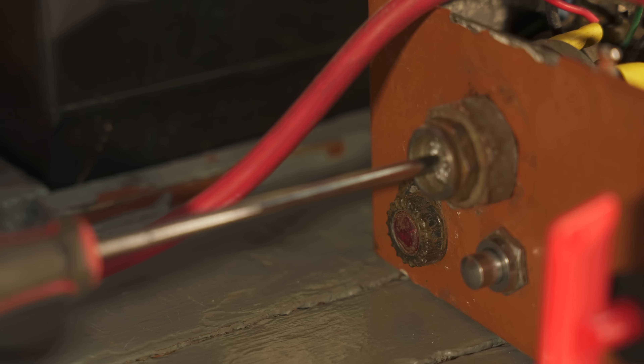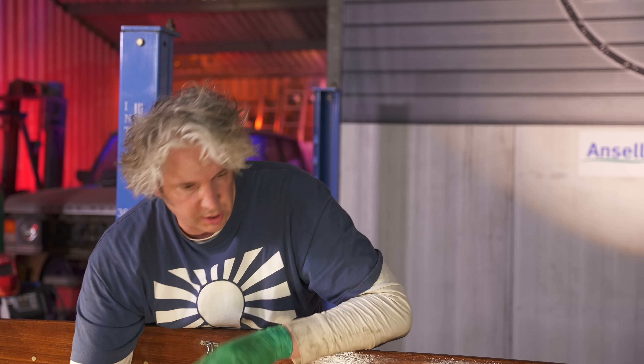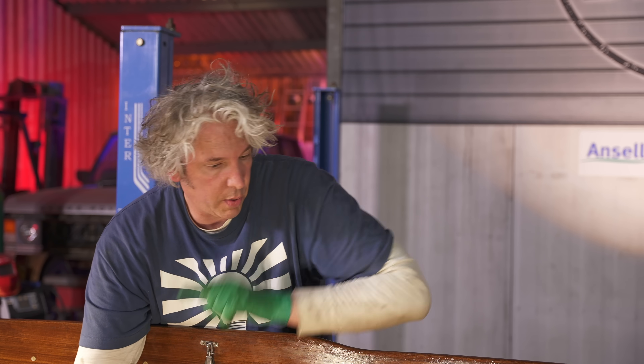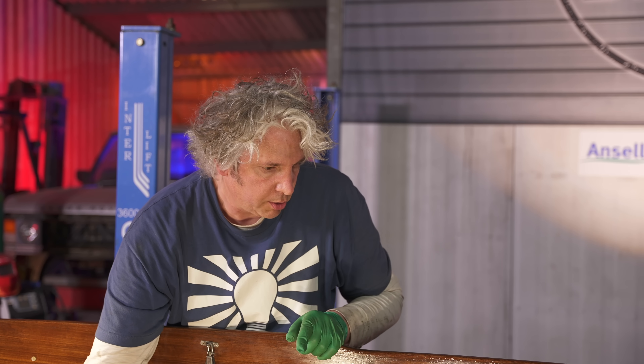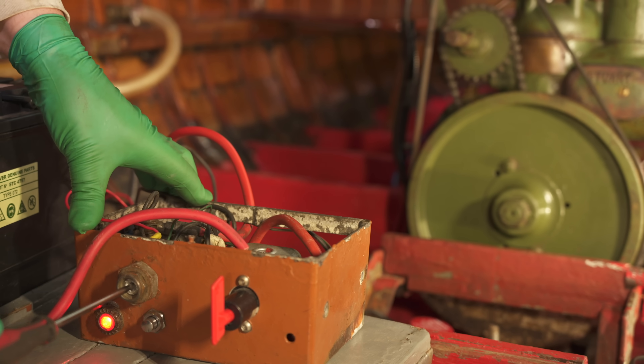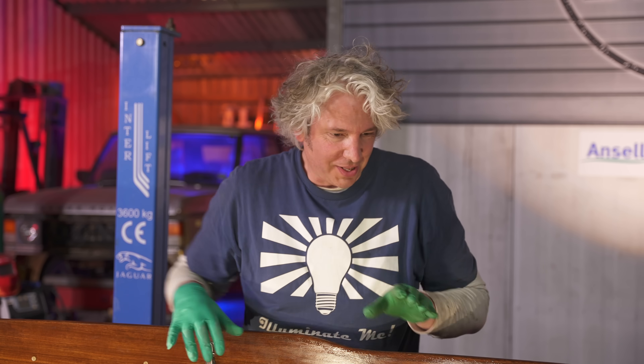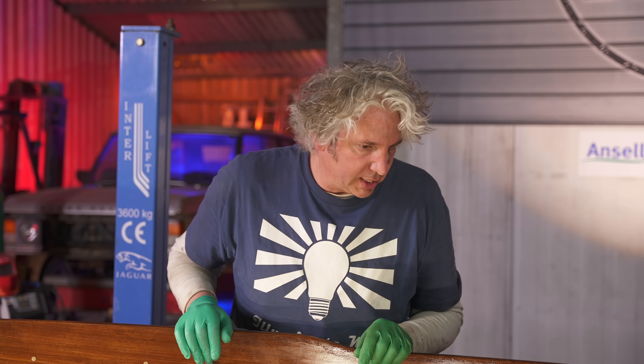So the next thing I guess is just to see what happens. Let me plug it in — it looks like the wires are all kind of going in the right sort of place, so let's hope nothing horrible happens. Here we go — I'm going to put on the ignition first of all. And we have a little red light, which is quite good news. So that means it's kind of back-feeding through this regulator — ultimately when the generator is spinning up and generating some voltage, that light should go out. So before we check for the spark, I'm just going to see if it actually turns over. That sounds great already — so our little Dynastart is doing the trick. It is spinning it over rather nicely.